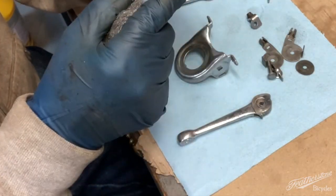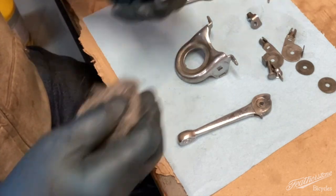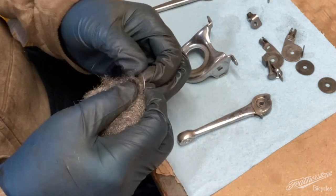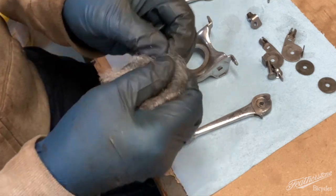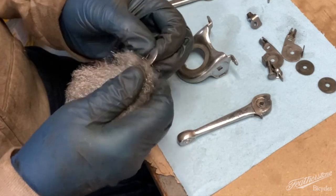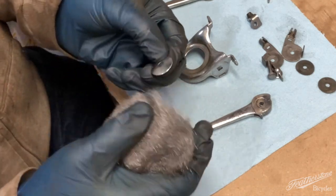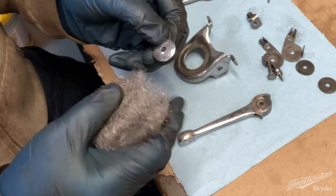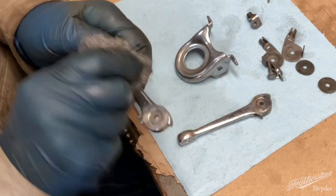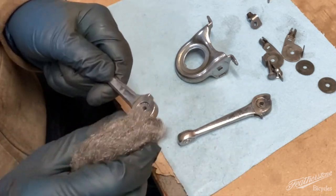Up the fibrous plastic, whatever they are, discs, a little bit with some very fine steel wool. And I also am touching up the metal pieces that I had on the wire wheel, because again, the wire wheel does a good job of taking the rust off, but it can also dull the chrome. I think it's because there might be some grease on some parts, certainly from when I had that chain on there. Didn't get all the grease off, and it can dull up these parts because of that. So after I used the wire wheel on them, I just rubbed some fine steel wool over them, and it brings the shine of the chrome back.